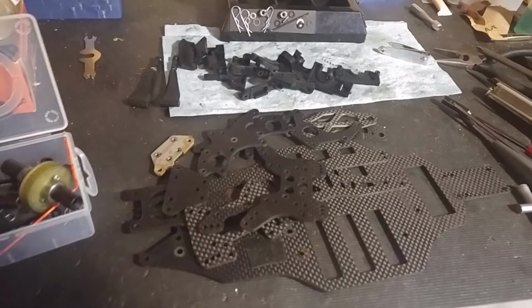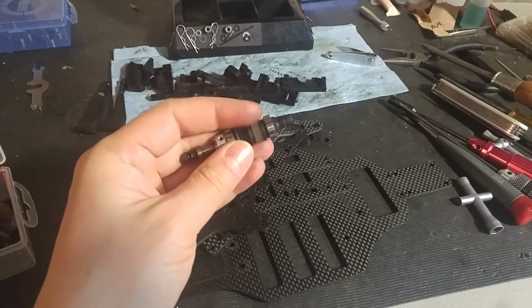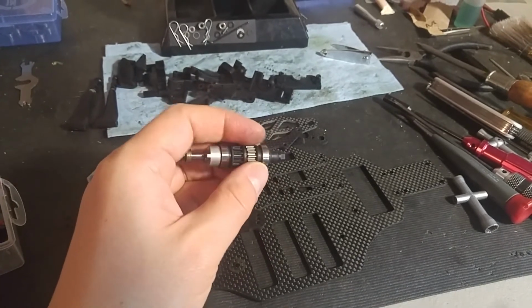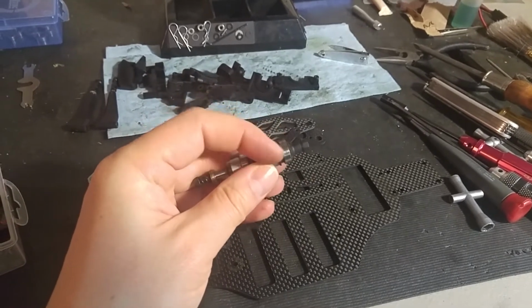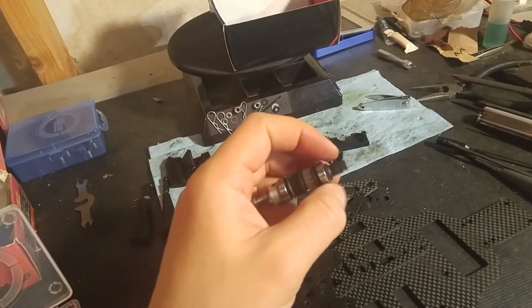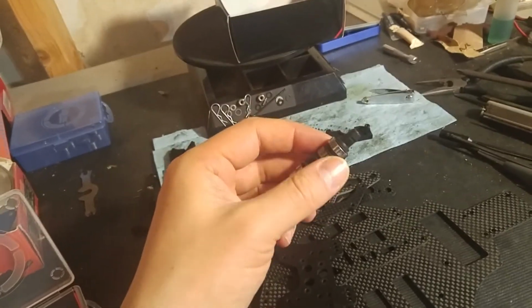The other thing I wanted to comment on is the lay shaft. I pointed out in the first video that I wasn't completely sure if this was assembled correctly. Turns out that it was, thankfully. So it's not missing any parts, but what it does suggest is, for this one way here for this pulley, it doesn't look like in the way that this is assembled that there's any friction plate here to drive binding in this one-way action. So you may recall on the prior Lazers, the ZX, the ZXR, and the ZXRR, this lay shaft is a little different, and there's a friction plate here which you can adjust with a nut on this side to adjust how much you want that one way to spin under full braking. This doesn't look like it offers that. It looks like it's a full one-way.